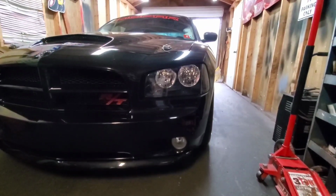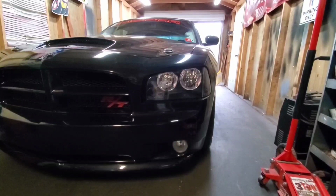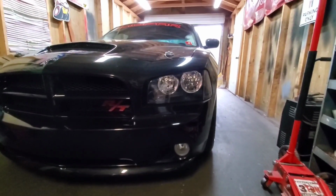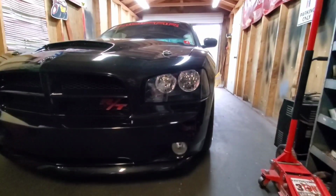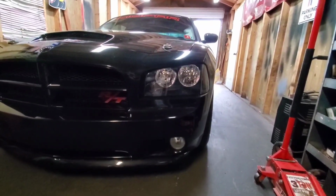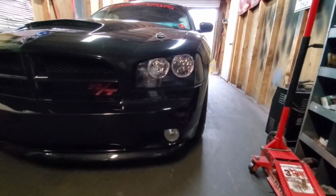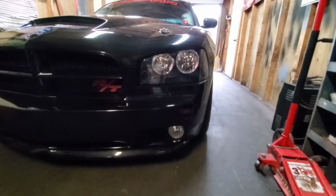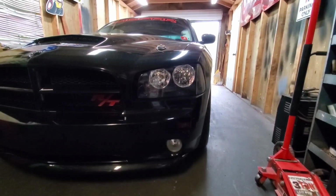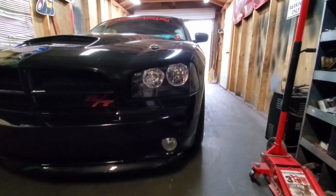The factory bushings that was in the differential, that was just recent where it started ripping and flexing those pretty good, so we upgraded. You could see it was flexing it pretty good. And the factory control arms with the worn out bushings, it was due for an upgrade. On suspension stuff, it didn't have no slop or any play in it, but you can see the bushings was starting to go. So it was about time to upgrade.